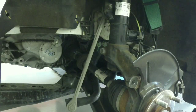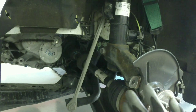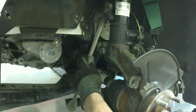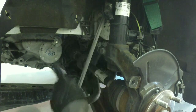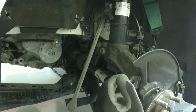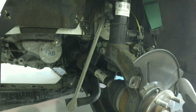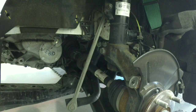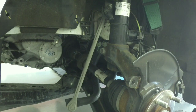I've already removed the underpan on the car, which I'll show you how to do in another episode. The first couple of things you're going to need to remove in order to remove this front sway bar is the sway bar end link, attached on the sway bar and on the strut with two 14 millimeter fasteners. To get those loose, you're also going to need to remove the tie rod end, which is on this side of the spindle — it's a 19 millimeter nut on top.